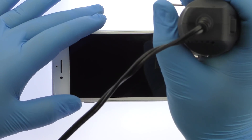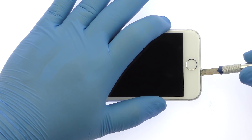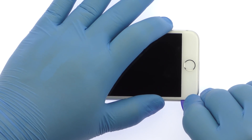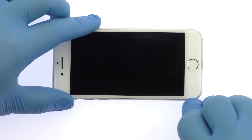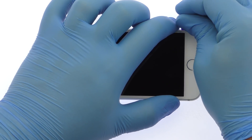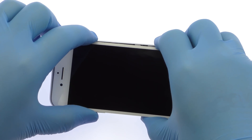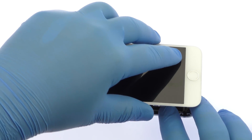Apply some heat and then use a precision knife to create enough space to insert a triangle opening tool. With the opening tool, slice through the adhesive and carefully decouple the iPhone 8 display assembly from the rear case. Just like the iPhone 7, it opens to the side. The display assembly is still connected to the iPhone by cables along the middle right side, so don't try to remove it entirely just yet.